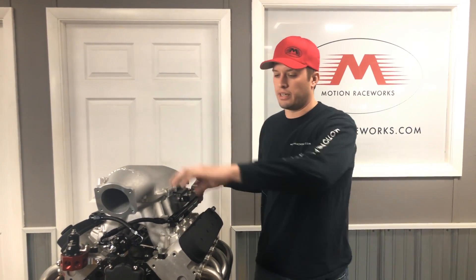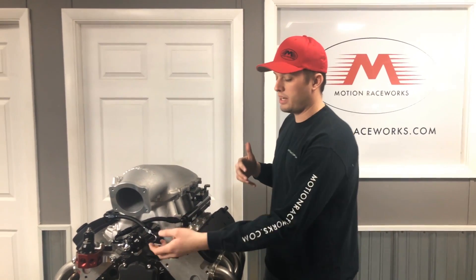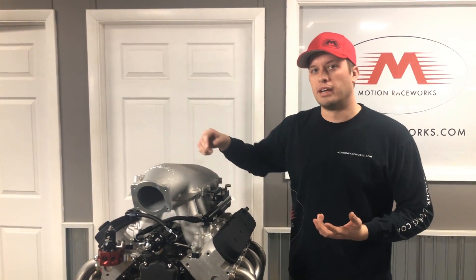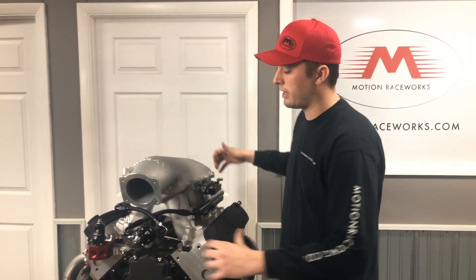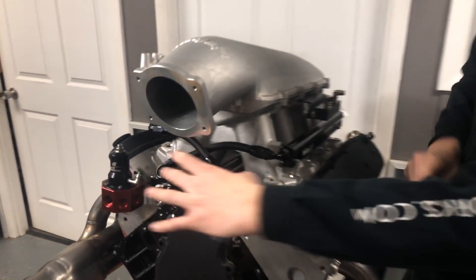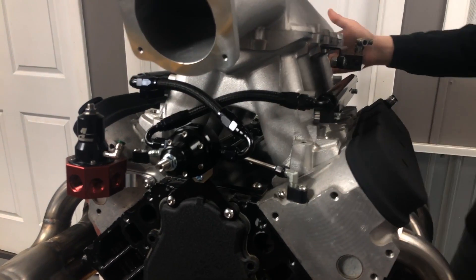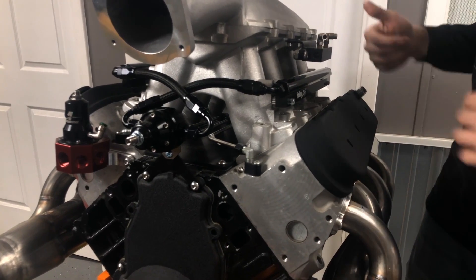I always try to tuck the regulator up front or down low and underneath the intake to minimize the amount of lines, because that's also a safety concern. On a turbo setup, lines draped all over the engine bay can get affected by heat, become brittle, crack, leak, or catch fire. So we run the fuel in, then it comes out of the front of the rails into the regulator. Everything behind that regulator is then properly regulated. If pressure gets low you can run lean on cylinders, so that's why we do it.